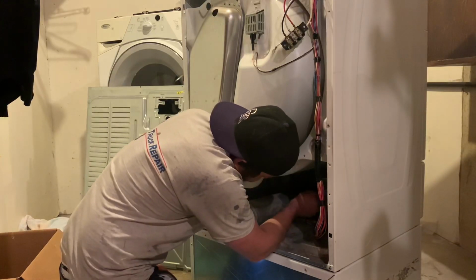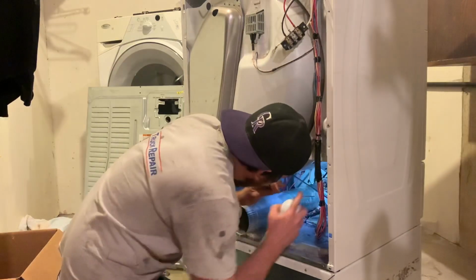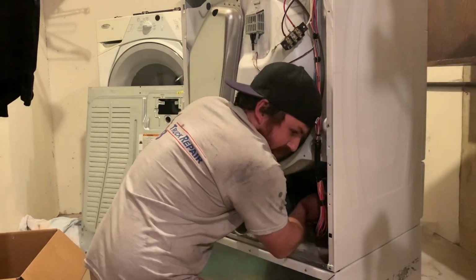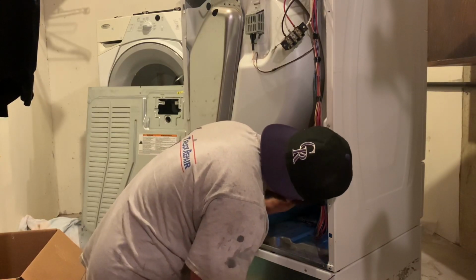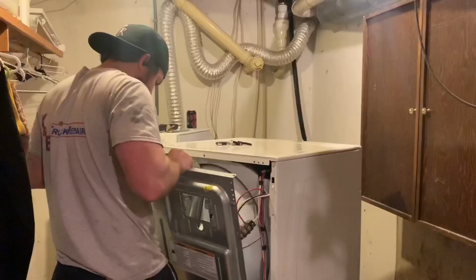Man, it's spinning pretty free. I don't hear any squeaking going on. Diagnose, repair, verify, test drive, burn out, then do your paperwork. I'm gonna try that for now, and once that oil spreads around, I think we'll be all right. And I don't hear any squeaking in any of the pulleys, so I'm thinking that squeal was all on the belt. Hope so.